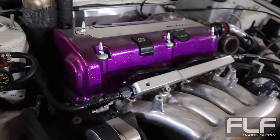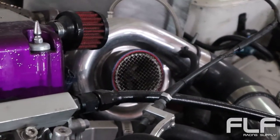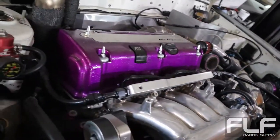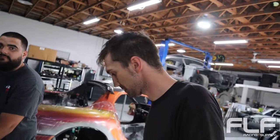Which is enough to bend the factory control arms and break axles. So there's some new axles and control arms being sorted out. It's a nice small turbo - should have a quick spool. It's instant - zero turbo lag on this car. That's what makes it scary because it comes on so hard. At least my Miata you can kind of anticipate it because it has a laggy turbo. Those quick turbos, you go from making like 100 horsepower to 500 in nothing.